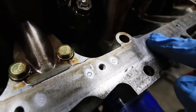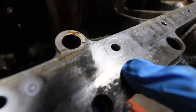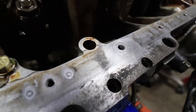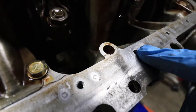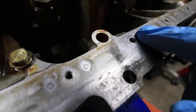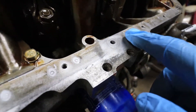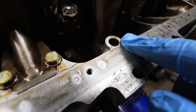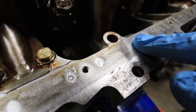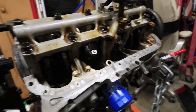The scoring on this is relatively deep. I'm not 100% sure how I'm going to deal with this. I don't know if it's going to be a big deal. But I think what I'm going to do is, when I go to put this gasket back on, I'm going to make sure that I fill these crevices with a little bit of Honda Bond and hopefully that is enough.